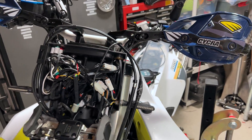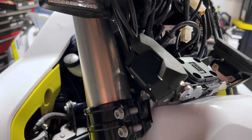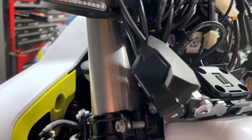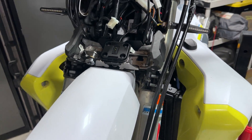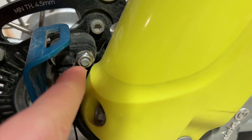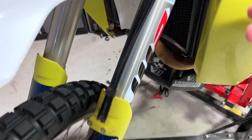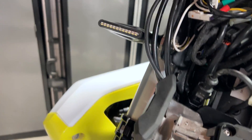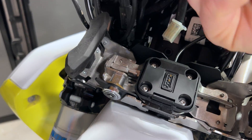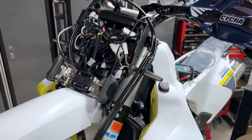You'll notice we have the cowl off the front of the light here — it's just a screw here and then two screws on the other side and one down there. Remove this off, you're going to have those little bits right there. Once this is out, you can basically trace this cable. We're going to be unhooking it from here — there's a nut right there to hold it in. It fishes around and comes right here. You have to unhook these two as well, then unclip the clips here and there. This traces around and goes right there.